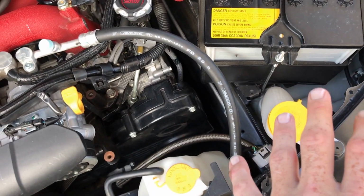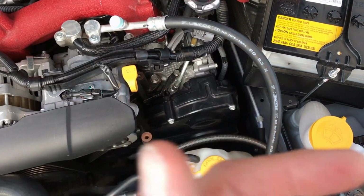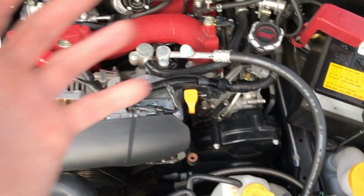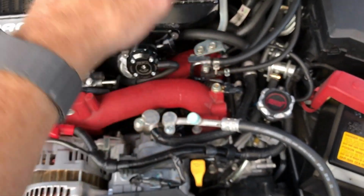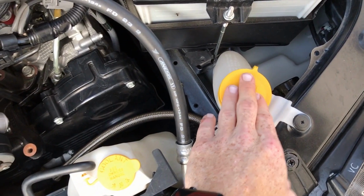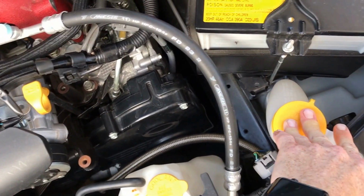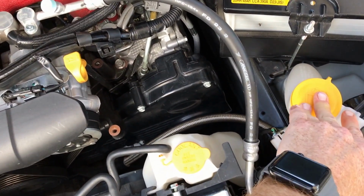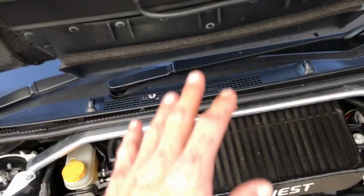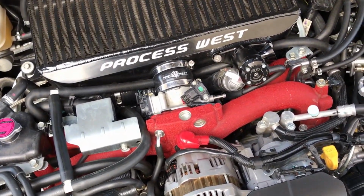Now with water that doesn't matter too much, because the water does evaporate, and evaporative cooling, you know, it's just like when you're wet and you come out of the ocean and the wind blows on you, you feel much cooler, because that's the way it works. So you do get a much better cooling effect from the water, just simply because the water has good thermal capacity, so it can take a lot of temperature out, even if the water itself is actually hot. And the fact that it's being atomized and sprayed up here, that also makes a big difference too. But it could be improved.